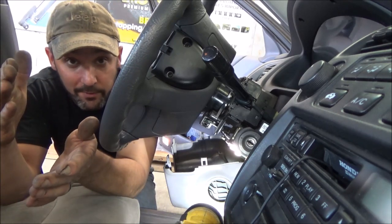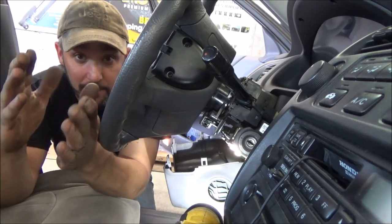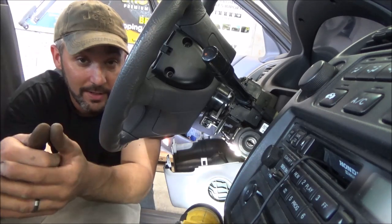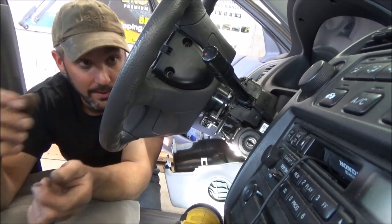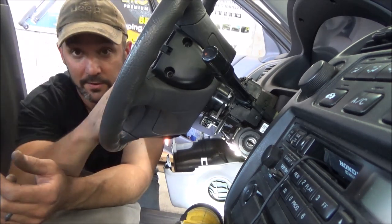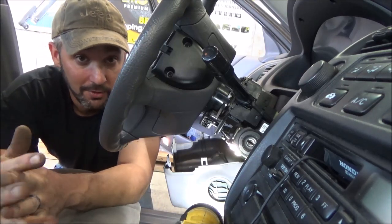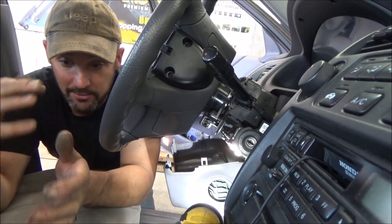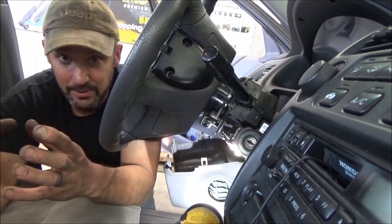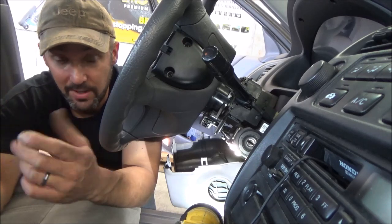If we take our clock spring and look at it as two halves — a first half and second half of the wiring — we can see the second half. Essentially all a clock spring is, is pretty much like a reel. Just like the wire diagram stated: you've got to be able to turn your steering wheel and use your buttons, horn, and whatever other accessories are on the steering wheel, and they must go through what we commonly call a clock spring. It basically allows your steering wheel to be turned left and right — it's essentially a reel of wires that winds and unwinds each time you turn your steering wheel.